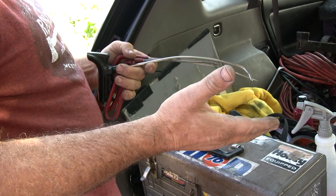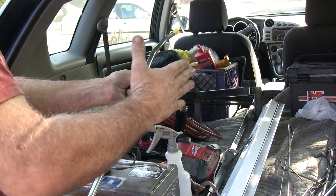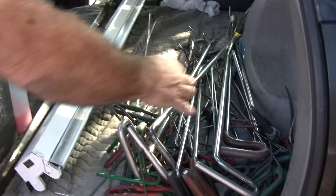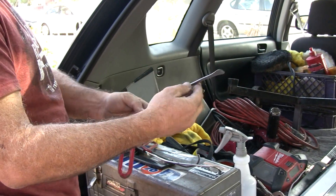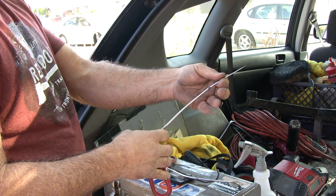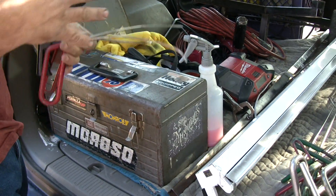Everything is leverage. In most cases you have a fulcrum point to leverage from. So if you've got a large opening, larger dent, a larger rod, larger diameter — no deflection when you bend — so any pressure that's given you've got no loss in deflection. It doesn't take very much pressure to have something like this push it out. You've got limited space and you get into something that's smaller, so whereas that one you're prying off of a point to leverage it out, this you're going to be in between two layers or two skins of steel and working on it. The leverage point is the same, it's a shorter distance, and it doesn't take a great deal of force or pressure to push it out.